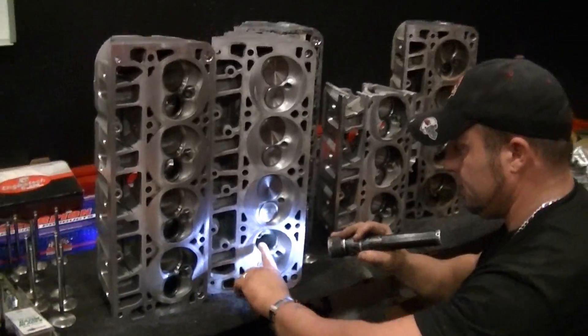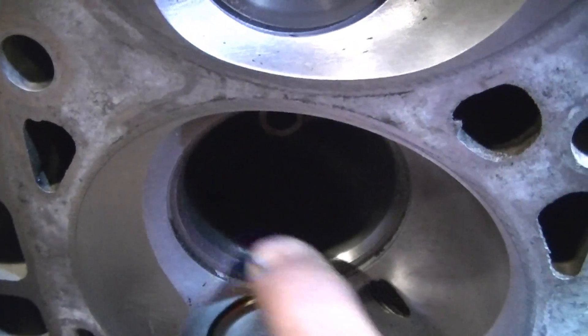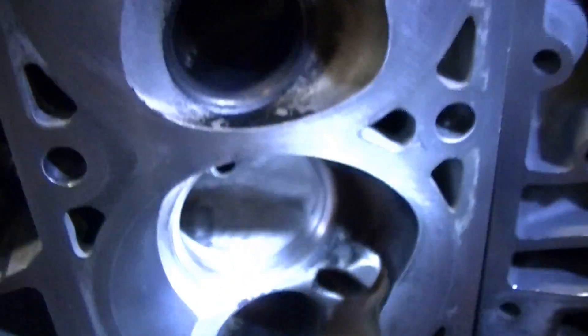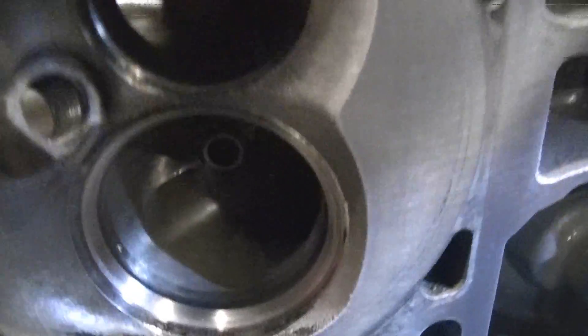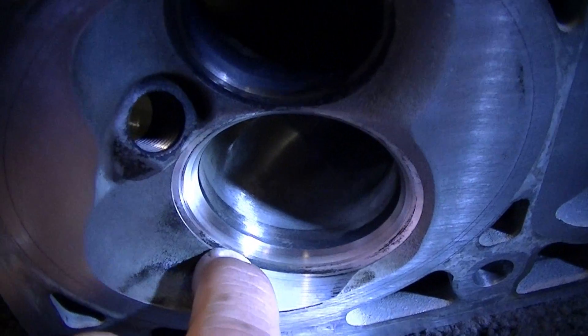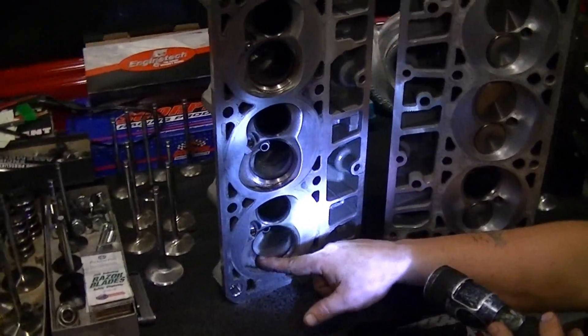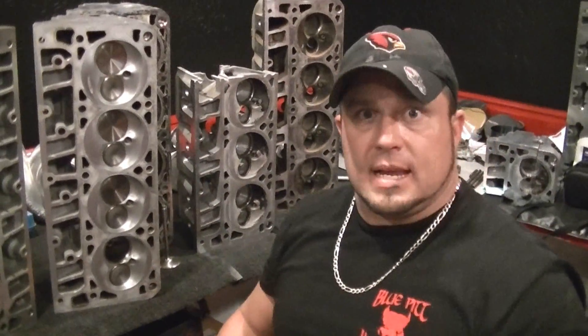You look at the seat from AFR — it only has a two-angle seat. You can see the material. Now you look at the LS3 seat — you notice the metal's a little bit discolored, it's a different color. You've got one, two, three angles on there. This is a factory head, this is a performance AFR head. The truck heads only have the two-cut boss angles. That kind of tells you the difference between the LS3 and the L92. We're going to take a break and then do the last segment, getting into the LS3 valves and a little bit of valve work.